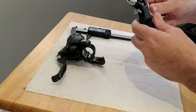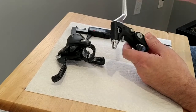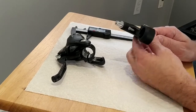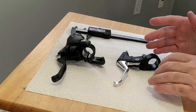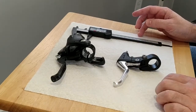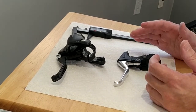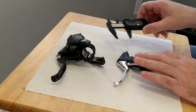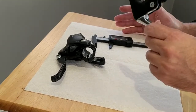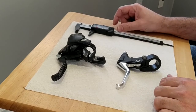So I thought: maybe if I install this lever on my bicycle — which has a long brake — it's not going to work. And indeed it doesn't. I tried it and you guys are going to see that next. I never found the threshold between long and short online. 29 millimeters seems to be short, 43 seems to be long. But it's very clear to see that one is very short and one is very long.